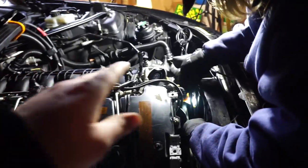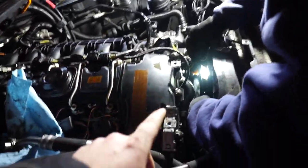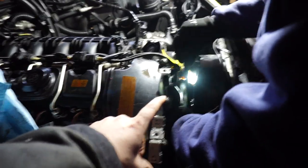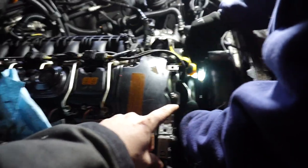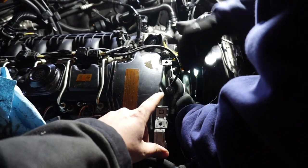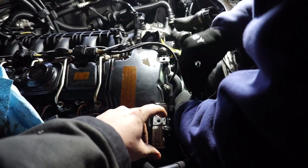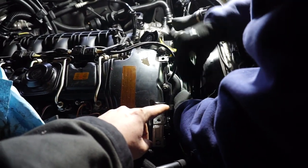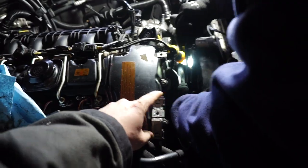Okay, guys, we got the whole oil filter housing off. Now Matt is taking out the two bolts that keep the charge pipe in place on the front of the motor. They're T30 Torx. One's kind of easy to get to, the other one's real hard. It's a little further down there. Yeah, it's a little further down and kind of hard to see, but it's doable. And then